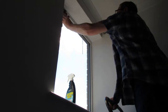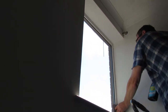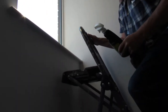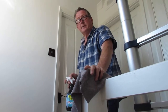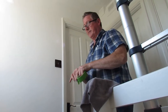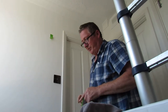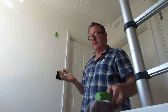Give it a good shine then we're going to do something — we're going to spray water on this window. For those who haven't installed this type of window film, it's quite an interesting way of installing. You basically use a soapy water solution, spray it onto the glass, then apply the film. It's not sticky-sticky — you put the water on with the solution, then the film, and then it sticks eventually. You'll need some masking tape — this is frog tape, because I know it's not going to rip the paint off the wall.